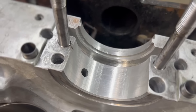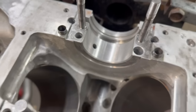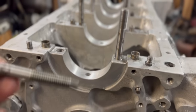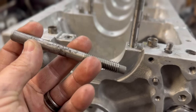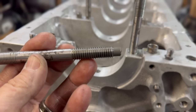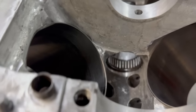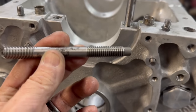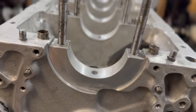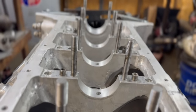You can see where they line honed it. One other thing interesting — true for both head studs and main studs: this bolt is a 7/16 fine thread on the left side and on the right side you see how long the thread is with this piece on the end. They actually machine the block and the head studs so you have to have a specific stud — it's a coarse thread. Screw these things in just finger tight. You never want to wrench on them and torque them down hard. Just finger tight and they are set.